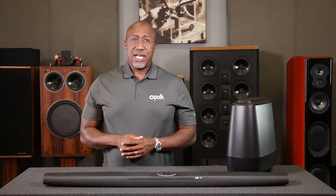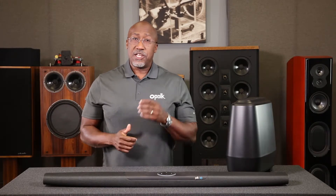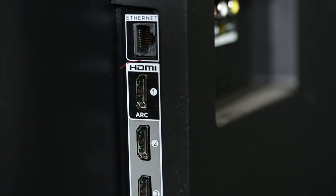If the Fire TV is not displayed, switch the TV to the HDMI input connected to the sound bar. If the sound bar is connected to a non-ARC-enabled HDMI input, you may also need to switch the Command Bar to HDMI number 2. Again, we recommend that if your TV has ARC compatibility, you should utilize it for simplified control.